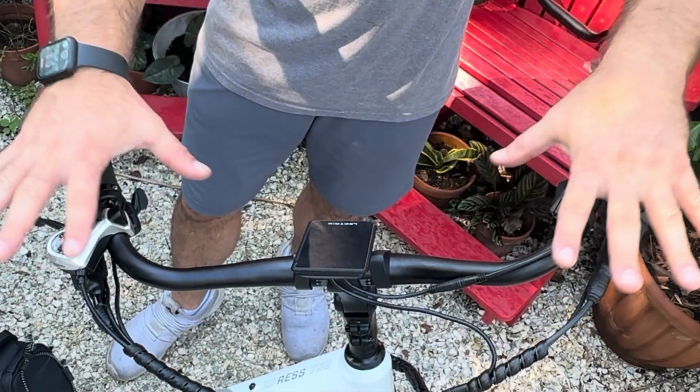Don't forget your cap is on the end — don't lose that. Make sure that you don't back off these screws so much that they fall out; you'll definitely want them to stay with the bike. I'm going to leave the assembly tied together for a moment, loosen up everything, and see if I can get it all off in one shot. The screw for the horizontal thumb throttle actually points down onto its housing — it is right here, and it does have a torque measurement of one newton meter, so keep that in mind.